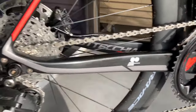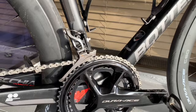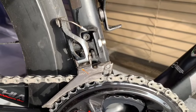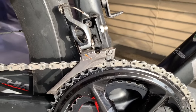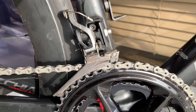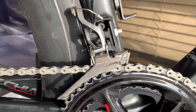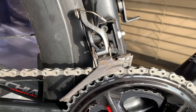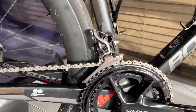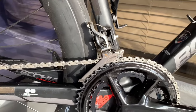The drivetrain is all 12-speed now except for the front derailleur. There are some chainline questions people might have, but I didn't have any problems dialing in the front derailleur — none whatsoever on the 12-speed crankset and 12-speed chain. I still get all four positions: top, top trim, low, and low trim. Everything just works fine. If there's any extreme chain angle, you do the trim and there's no more rubbing on the front derailleur.